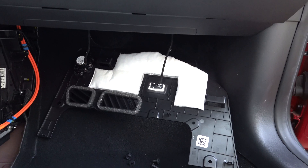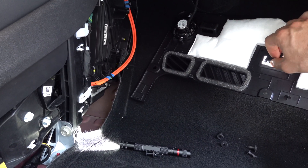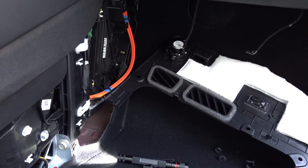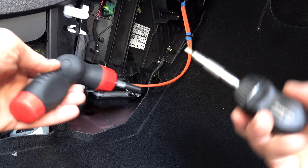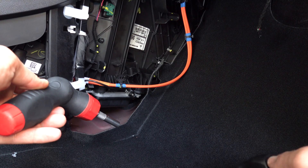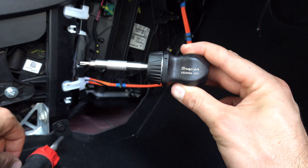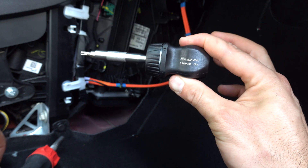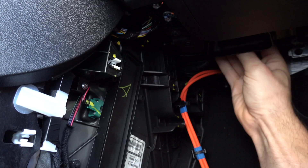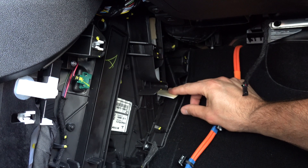So four clips — just work your hand in there and pull back a little bit. Be careful as it comes out; you've got one power cable for the light and one for the little beeper thing. These have pretty easy disconnects, but you don't want to rip a cable. Here's where your T20 bit comes in. A big tool won't fit — this little mini screwdriver will fit right in there. It's all about having the right tool for the job. Once that screw is out, you just pull the panel off and there should be a little tab right here.